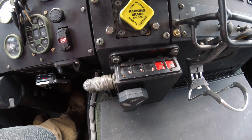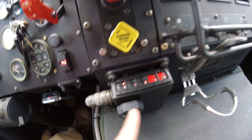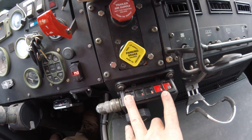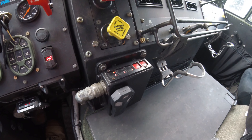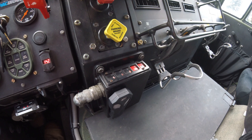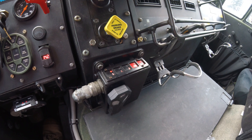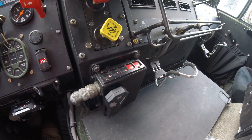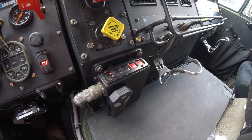At some point, probably around 115 psi, this is going to start going crazy. It's going to try to fill the tires and then go into this cyclic mode where one or all of the terrain lights are lit, basically saying it can't fix the system and needs you to intervene. It was intermittent at the time — I was able to get it working temporarily so we could get home. Let's stand by and see what it does.